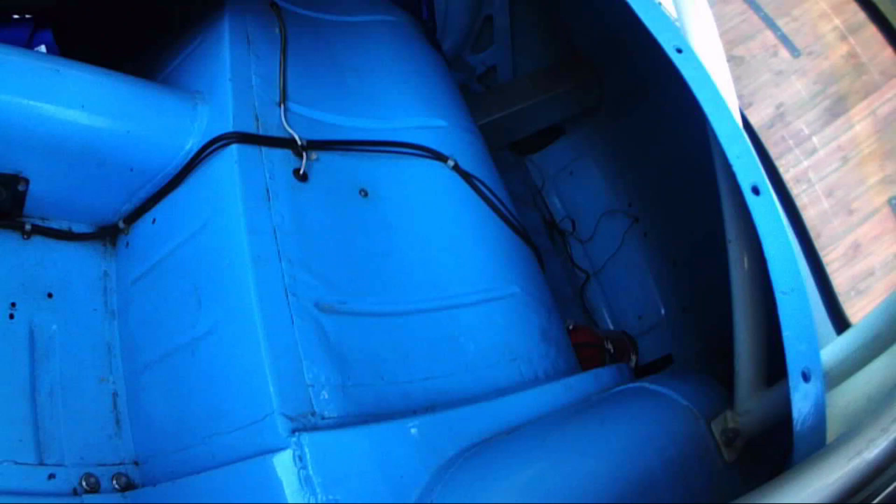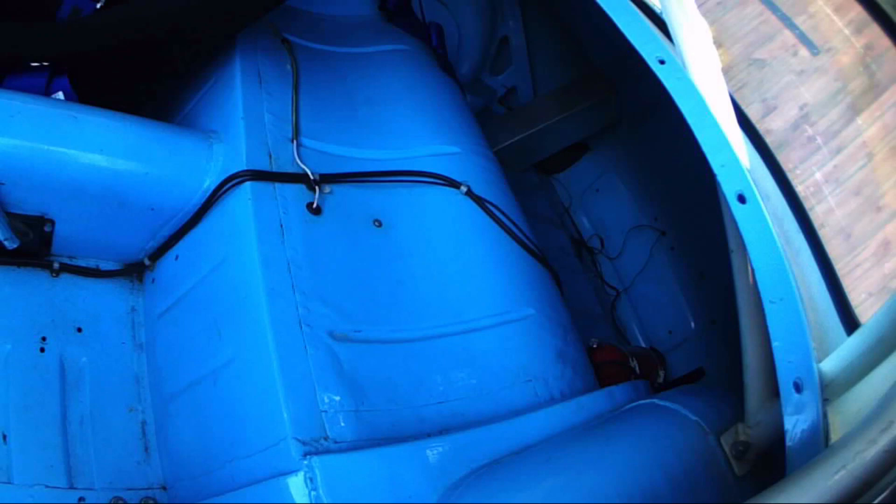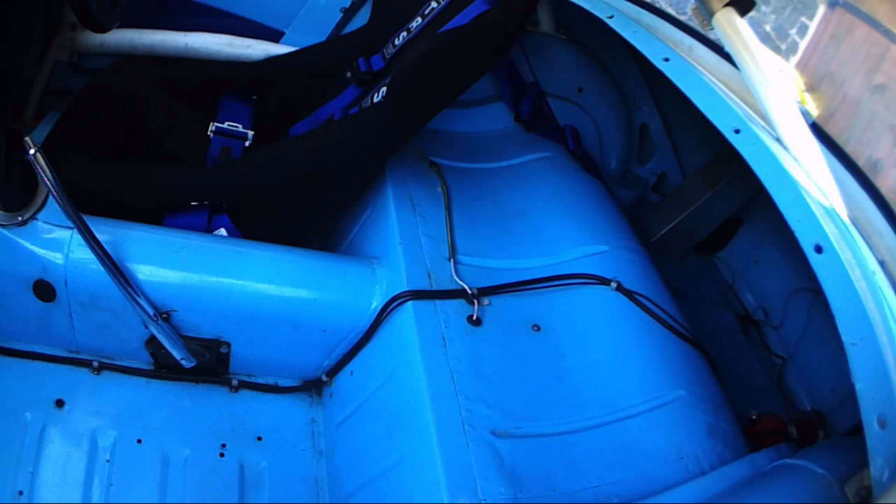This particular car has a fireproof cover over the filler cap, because the tank is under the floor and the filler is on the outside of the bodywork. Rear seat belt mountings — I would suggest that's about as low an angle as you want. The angles are in the Motorsport Yearbook.